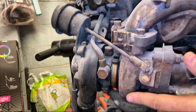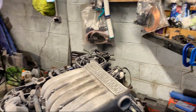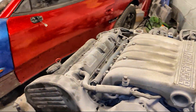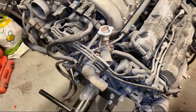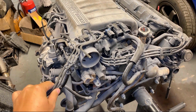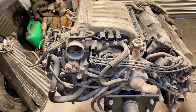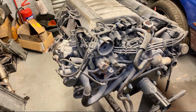These are the tiny turbos — that's my hand for scale and I've got average-sized hands, but that turbo is dinky. There's one on the front and one on the back — they're only small. Ideally I will recondition the turbos before they go back on; I don't want them going bang and taking the engine with them. The throttle body is all in good condition and these throttle bodies are water cooled — coolant runs through them. All the plugs are in good condition, they haven't snapped, got lucky taking them off.